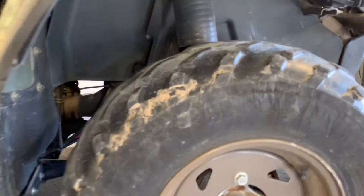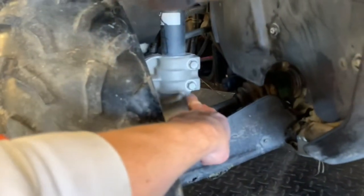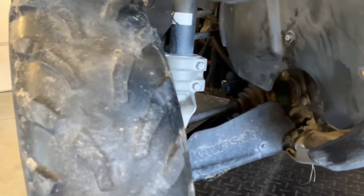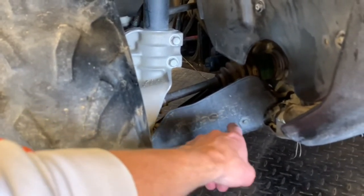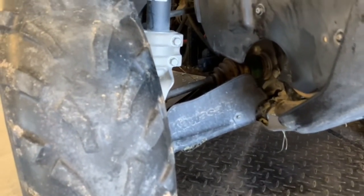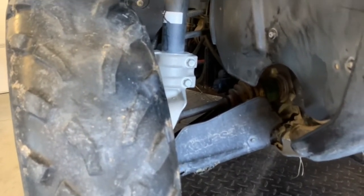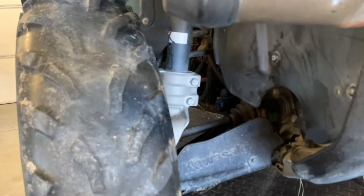Your front shocks are right here — two of them. This is the strut or spindle of the four-wheeler, and inside the spindle are your CV joints and your axle. You've got the same setup on both the right and left-hand sides. This is a CV boot guard — some people call them an A-arm guard. Make sure those are in good condition; without them, those boots will rip. Even a tiny pinhole in a CV boot will lead to a bad joint, so replace the boot early — it's a lot cheaper than replacing the joint or the axle.